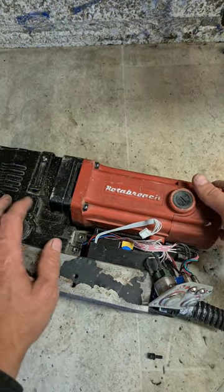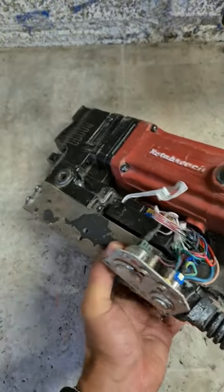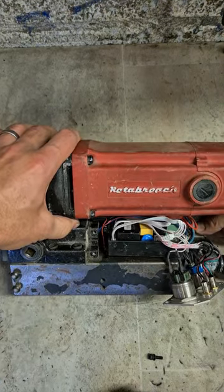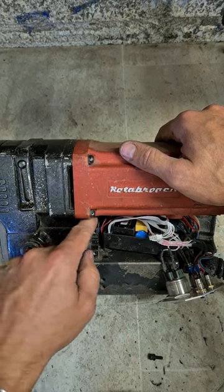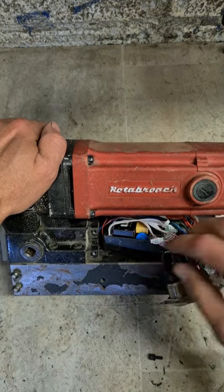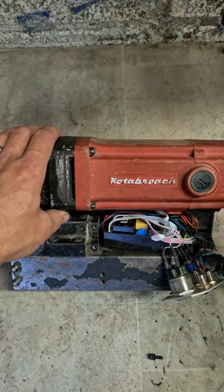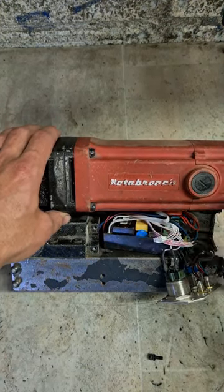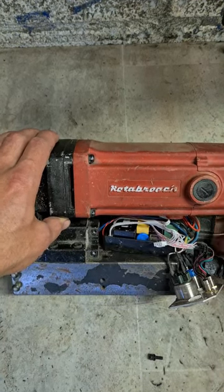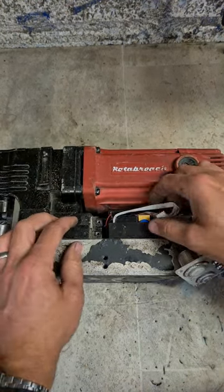Another problem: normally these boards go — you'll see a black mark somewhere, something will pop. When it doesn't start like that, it's normally something simple. Somebody has nipped the wire, and it hasn't been assembled properly. It's not the greatest design — it's hard enough to get all these wires on. They should have some sort of strain relief here to stop the wires getting pinched. So that is the lead to the magnet, and it's been pinched and broken. That's why the magnet's not working — we have to solder that.